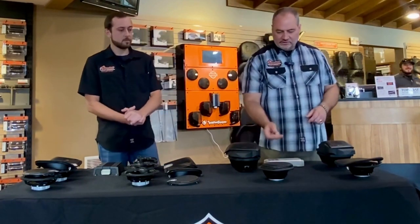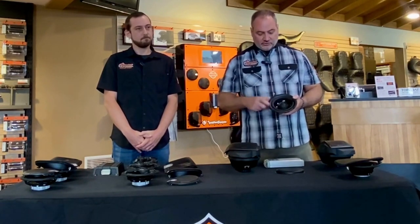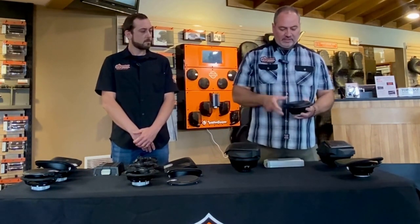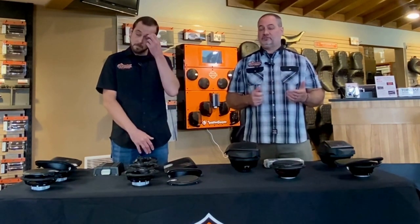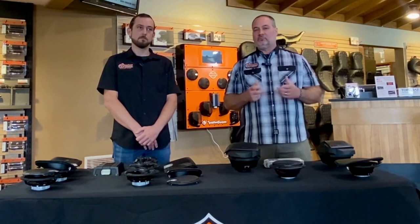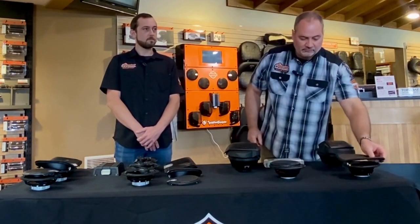There's a differentiation between these speakers even though both are designed by Rockford Fosgate. This is a six-and-a-half inch speaker that goes in a saddlebag, tour pack pod, or the fairing of a touring bike — a two-way speaker, and again waterproof marine-grade speakers. We caution customers: make sure you know exactly what you're buying, because there are companies out there that sell great-sounding systems with water-resistant speakers or even paper cone speakers. If those get wet you have to wait for them to dry or you can tear the cones. With a Rockford system, the speakers themselves are similar but it comes with different grills for your Street Glide or Road Glide — batwing or shark nose fairing — so there are multiple options.